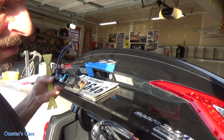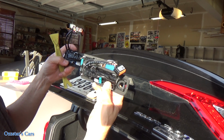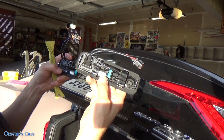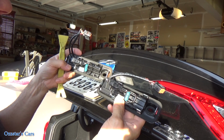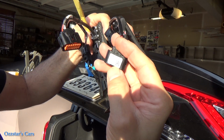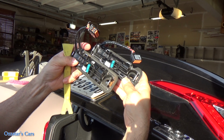All right, some words of wisdom when you're replacing this stuff, especially these backup cameras. I've done several Hyundais, and it seems like even a couple of years and they change whatever, you have to get a different part. So make sure you get the right part. I think this one is 2014 to 16, something like that. The Sonatas may all look alike for many years, but they'll change this stuff up, and I can't guarantee if they'll work or not if you don't get the right part. And that usually is listed over here on your connector, so you can see, hopefully, that I'll list it for this particular car. But anyway, the old looks exactly like the new, so that's good.